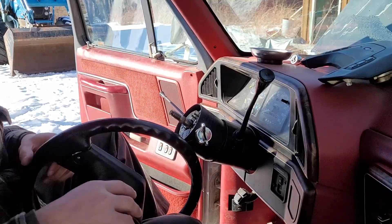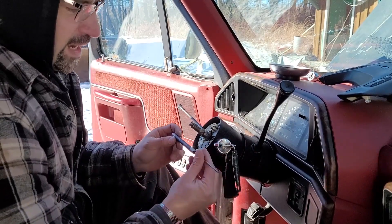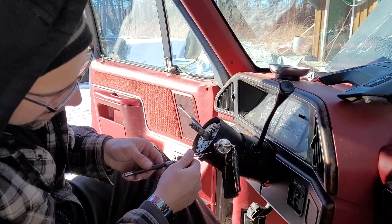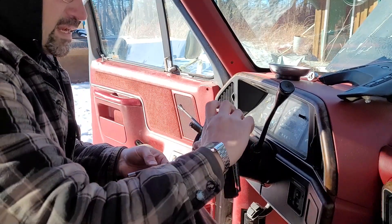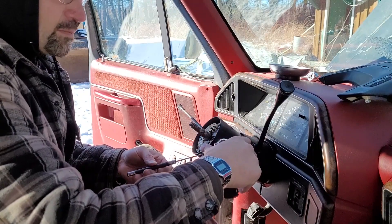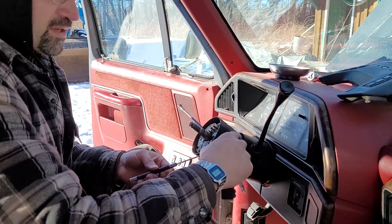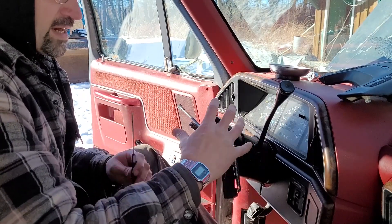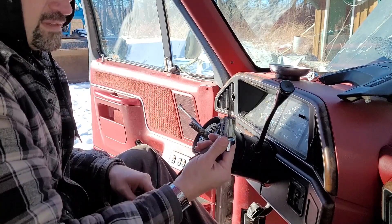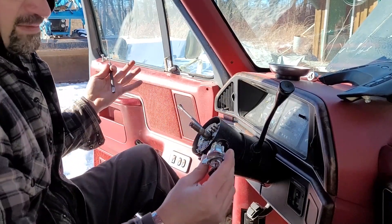After a little playing around, I finally got the tumbler out. I used a punch, placed it in a little pin hole, pushed the key to the start position, jiggled it around, and it eventually pops out. I did it twice just to make sure. The tumbler comes right out — you obviously need the original key or this doesn't work.